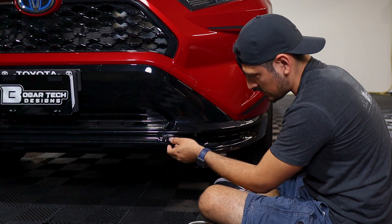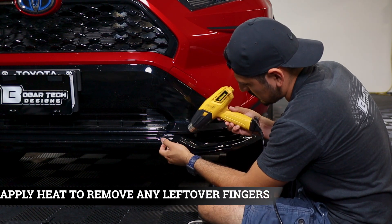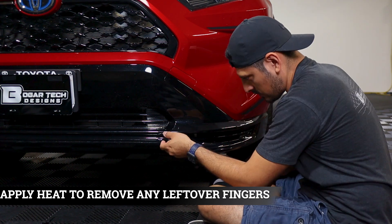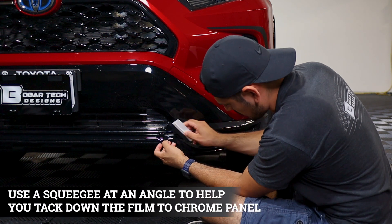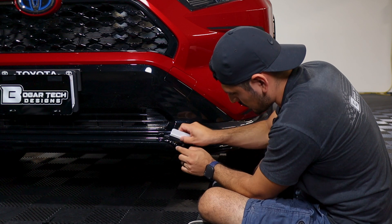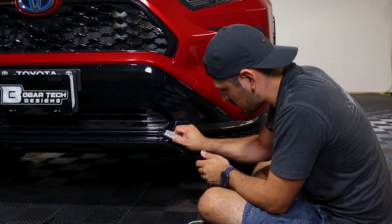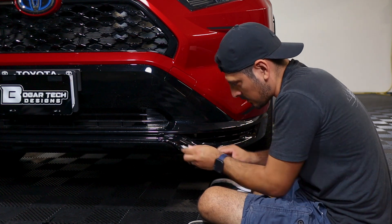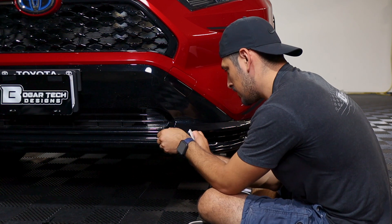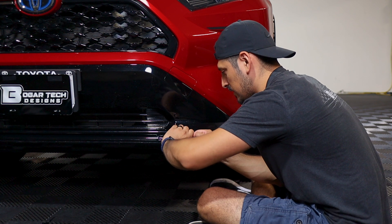You do have a little bit of excess material where there are fingers. To remove them, apply heat and then tack it down with your finger or squeegee. Let it cool off and then squeegee at an angle to avoid creasing the film. All we're doing is covering the chrome. If you have fingers right on the edge, you would trim them off — that's fine as long as you don't have fingers on the actual panel. Finish off with the top piece by lifting it carefully and tacking it down.